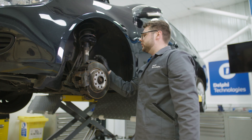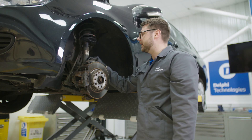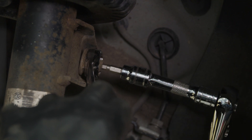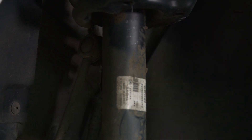Once the wheel's off, we can check to see what needs to be moved out of the way. In this case, we need to move the brake line bracket and also move the drop link. We need a 19mm spanner and we're going to loosen the nut from the drop link. Now we've removed the nut, we can remove the drop link.